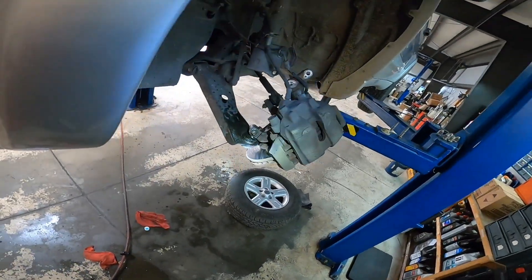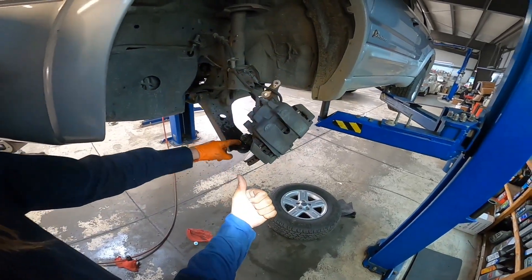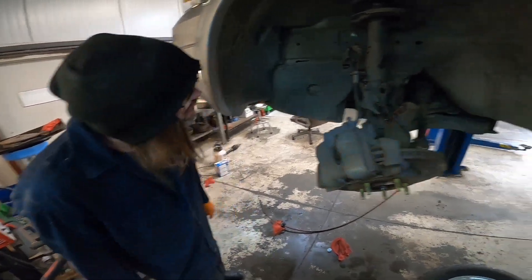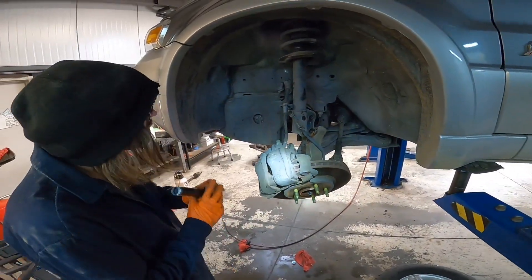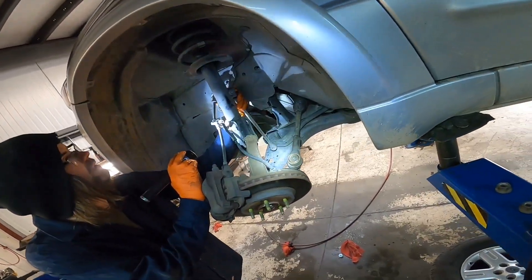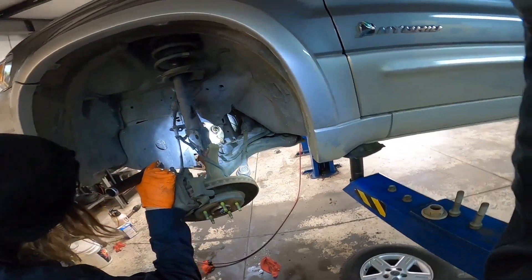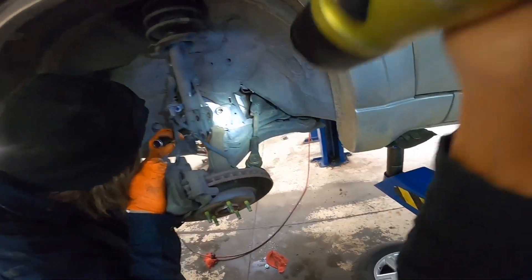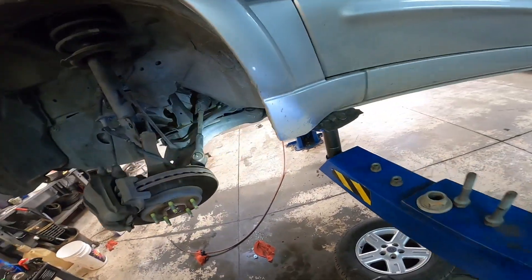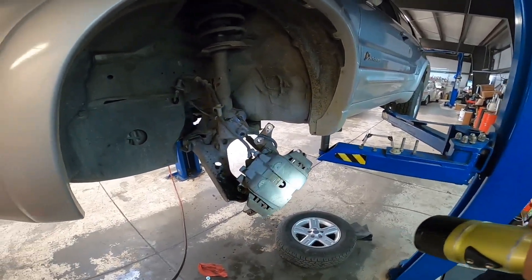In this case the lower ball joint is blown out, so we're probably going to replace that. Make sure you guys check your ball joints. You can also check your sway links here — these are usually pretty tight and last a long time on these. Make sure your axle seal in there is not torn. And while you're here, you can also check your brakes — they're about 50-60% life.